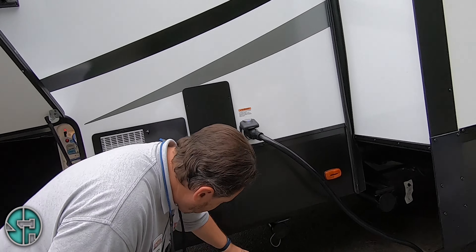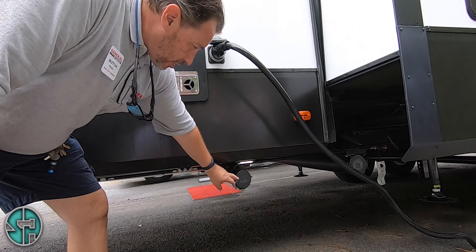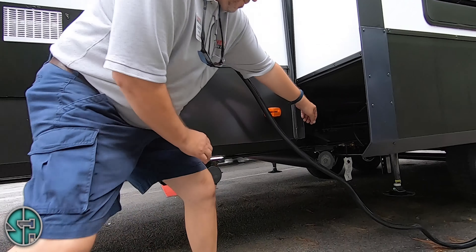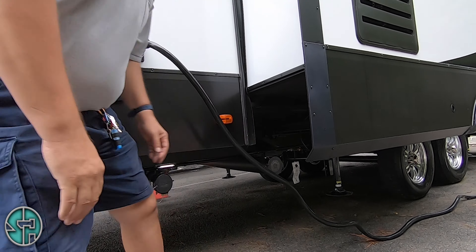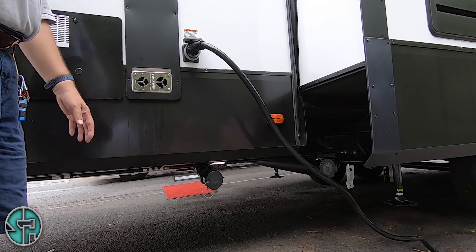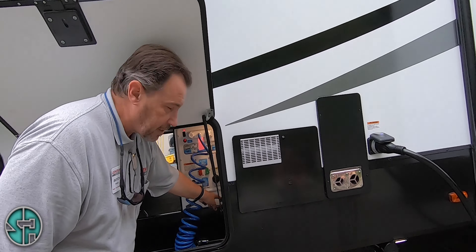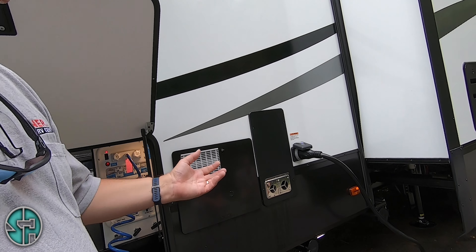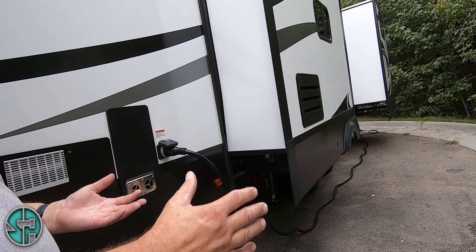You've got a little LED light here — a push button LED light so you can see it at night. This is one of your sewer hookups. You have one towards the back right here. Open that — sewer hose storage. You've got two grays and a black. What you want to do first is pull your black, because that's going to empty everything out of your toilet. I suggest having a clear end on your sewer hose so you can see when it's finished running.